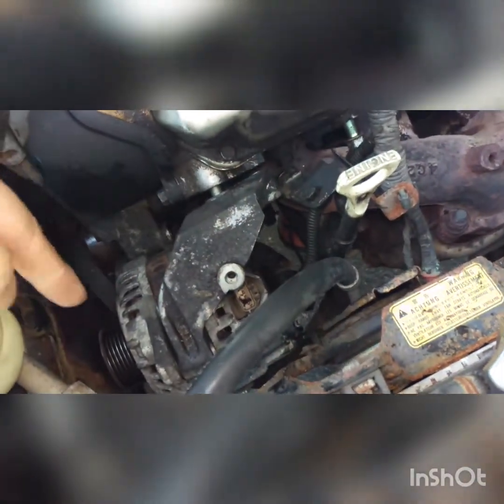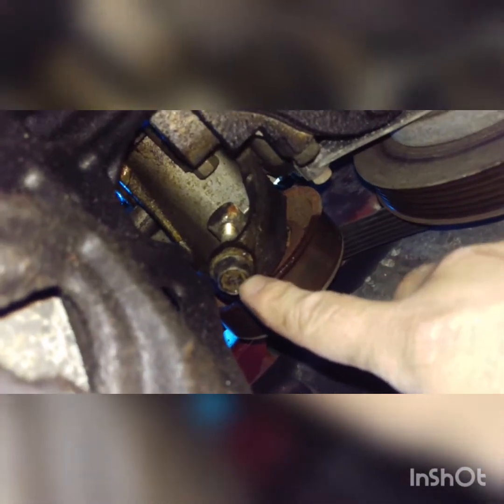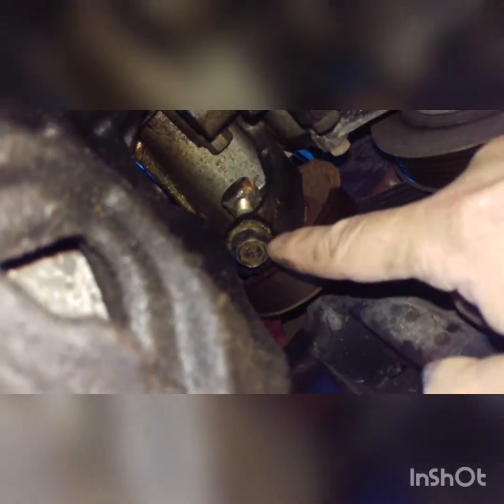They say there's an adjuster pulley, and we couldn't find it at first. To get the belt off, you've got to go underneath. There's the pulley and there's an adjuster bolt — I think it's a 14 millimeter — and it's on a slider, so you loosen this up and it goes up. It may be stuck even after you put some penetrator on it; I had to beat it a bit before we got the belt off. That's the adjuster pulley down here.